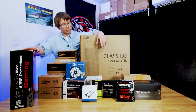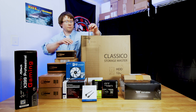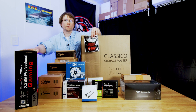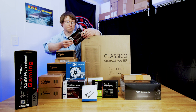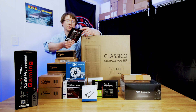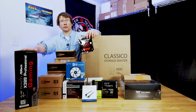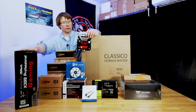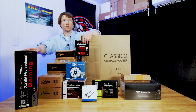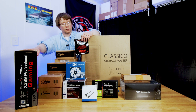We've got our power supply over there. We're also going to be using a Thermal Grizzly carbon thermal pad. Instead of using thermal paste, it's just a square thermal pad that doesn't dry out — good for long service life systems like this is going to be. I don't intend to have to repaste this. It's not quite as good as thermal paste, but I don't intend to load the processor heavily, so it should work fine for this application.